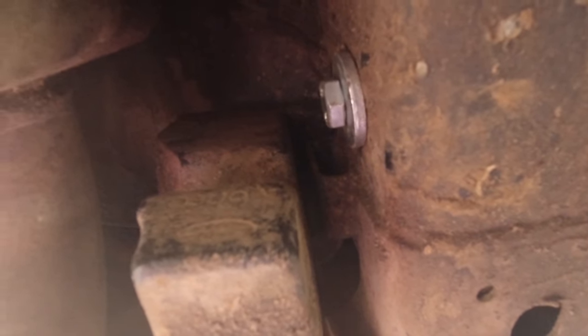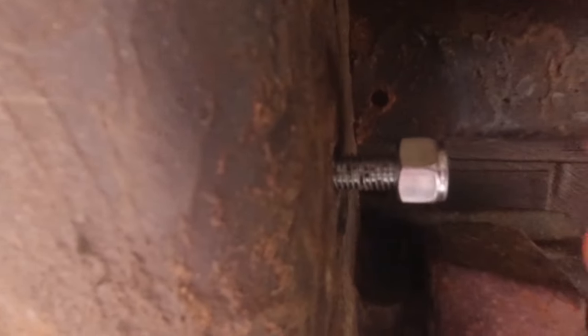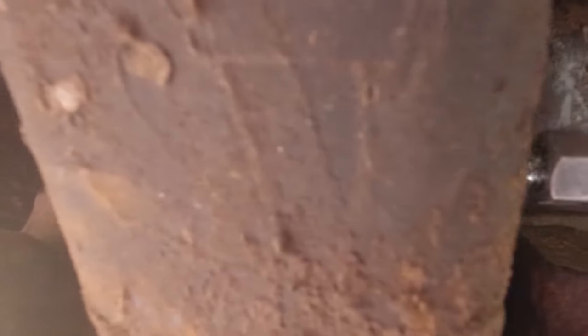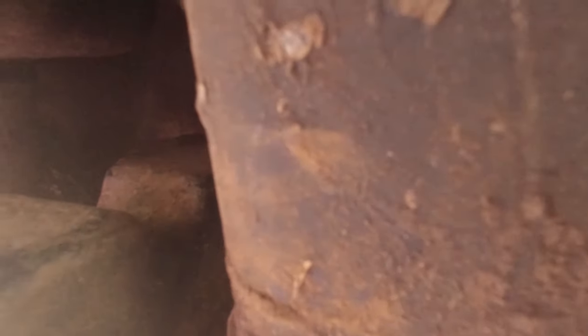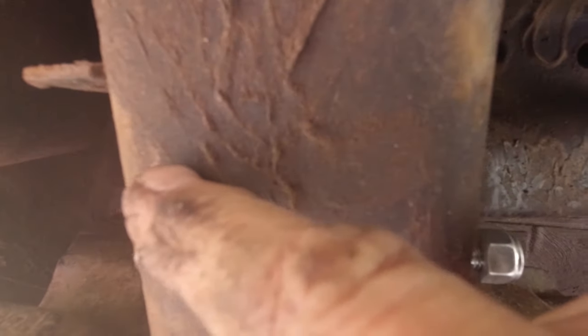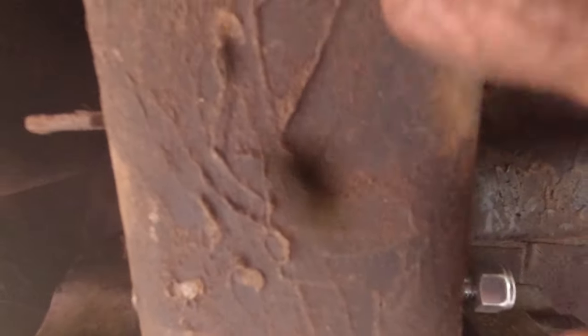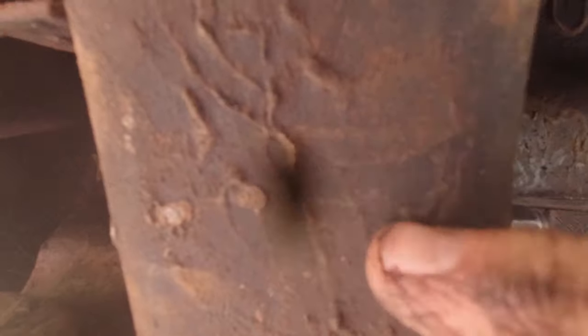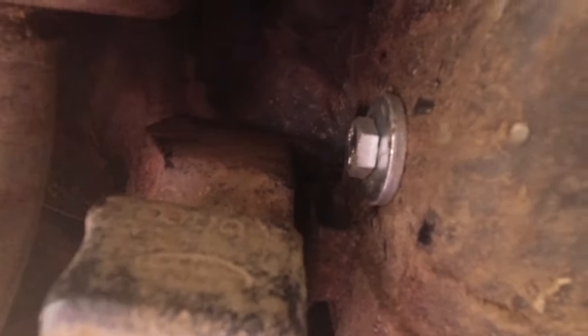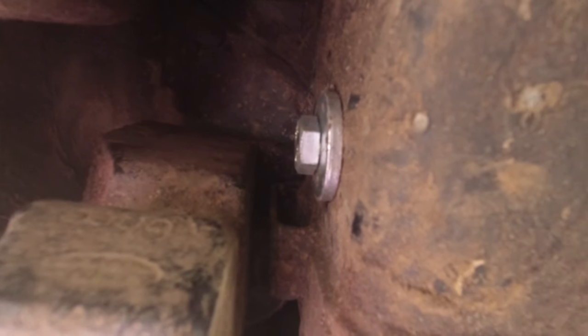So that's one. That bolt there is now through the chassis member and out the other side. The nuts on loose, ready to take the first bracket. It's the same on the other side. Nice fit now, but the spacer tube sits internal to this cross member, the chassis member, sorry, and you fit it in through an elongated hole on this side, and then the bolt drops back down the slot again. It's in, it's done, but it was a bit of a faff.